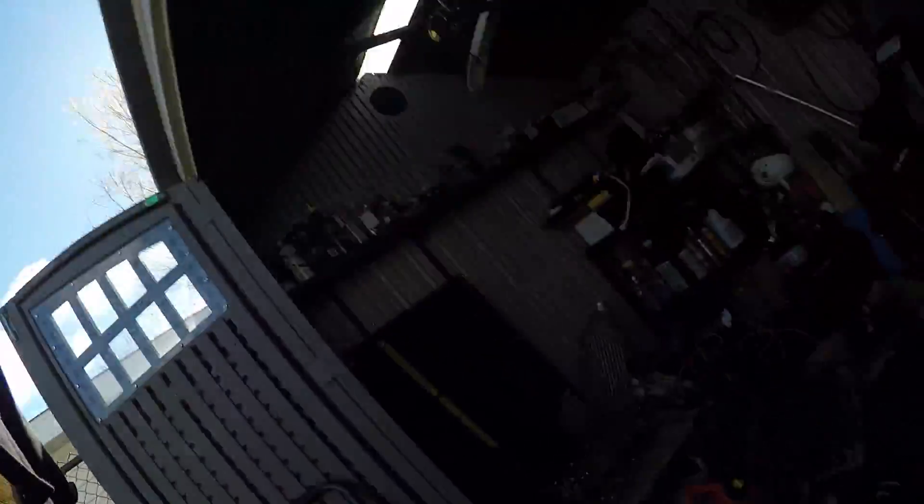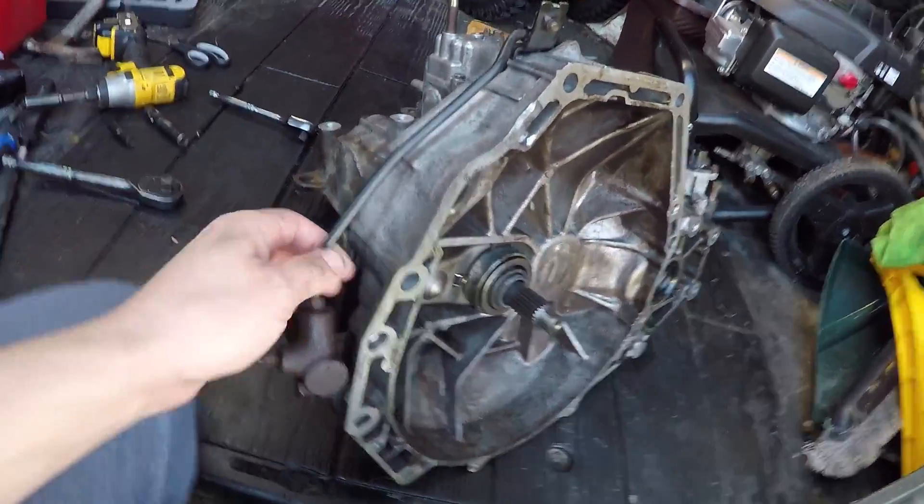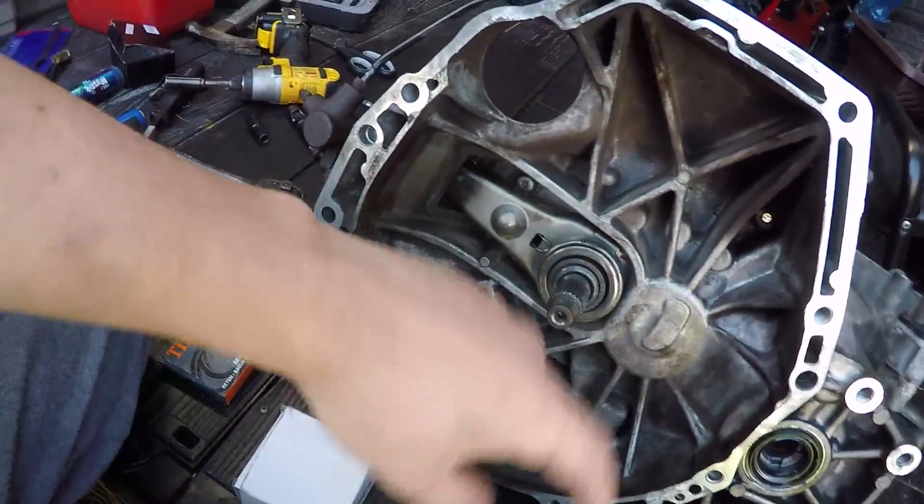Lots of progress made this morning — quite happy with it. Everything has been reassembled as you can see. Assembly was quite easy compared to disassembly because I already knew where things were supposed to be, and putting things back in is usually easier since they're not rusted. Now I have a new main seal and a new throwout bearing, so I'll be pulling the bearing out, lubing the shaft, lubing the bearing, lubing the hydraulic nub, and hopefully putting the transmission back into the car today. Next step: remove that bearing, replace the seal, replace the bearing, put it back in the car.